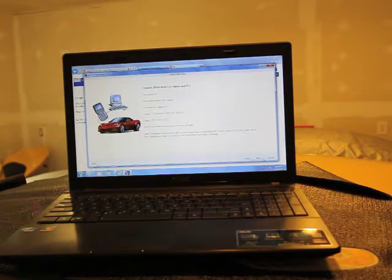Now we're hooked up to the car with our pass-through device. We're logged into what is called the Service Programming System, which is available through General Motors Aftermarket or ACDelco. This is exactly what the dealership uses to program. They're going to be using a different pass-through device — the MDI or MDI-2 — but we're using a generic pass-through device for this particular application. There is absolutely no difference doing it on the car this way.